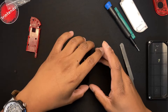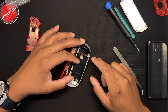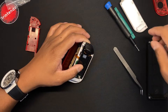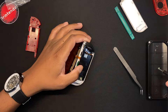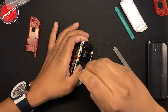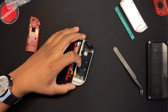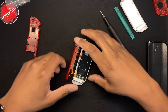Move any cables out of the way. The ribbon cable for the ZL should be folded underneath the middle plate. Once that's in place, push down and make sure it's aligned properly, then start screwing in the three additional screws for the middle plate. It's important to put all the screws back — if you don't, there's a possibility the Joy-Con might bulge and feel fatter than it should.